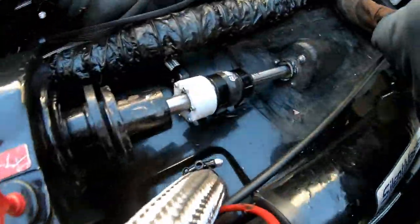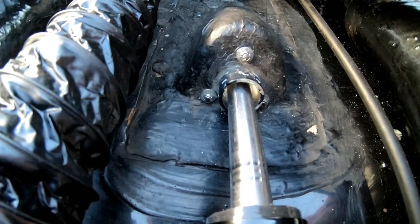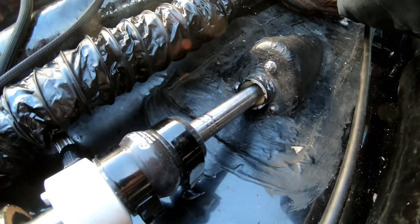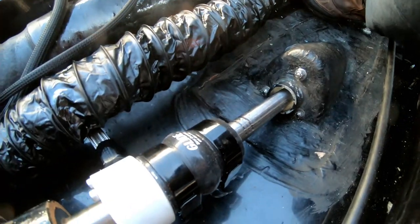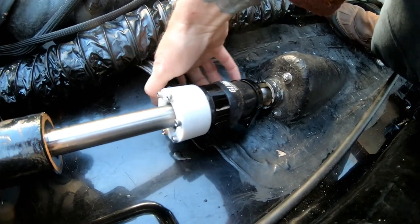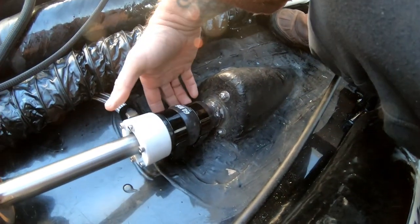Woohoo! Okay, after a lot of work, we pretty much have the shaft more or less aligned. It comes through the shaft log as opposed to all the way on the side, and it looks pretty good top to bottom as well. Now the Glide is pretty much lining up. It's going to seat on there pretty good now.